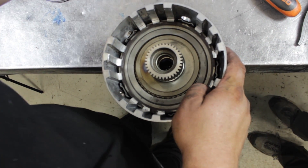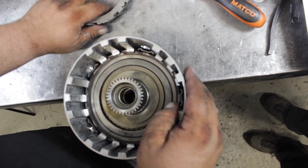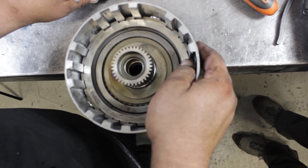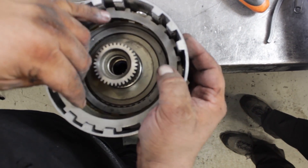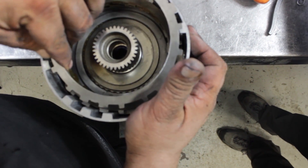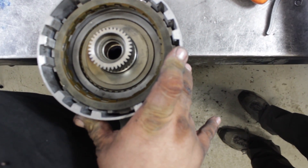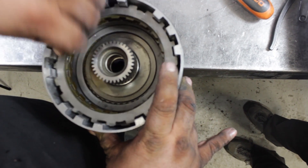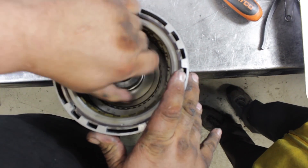After that snap ring is down, here's the other clutch pack. You see how it's got the foot here? This actually rides on that cage. This is the three-four clutches, also called the directs. They come on in third, and the only thing that changes it to fourth is the second gear band comes back on. The small teeth go here to leave an opening. The newer models have a little return spring that goes down in that hole. Some 700R4s didn't have it, and this one did not — but if it did, you could put it down in that hole.